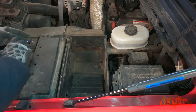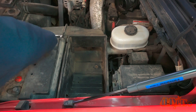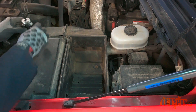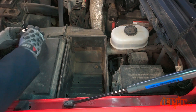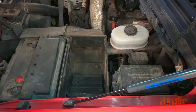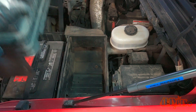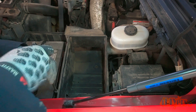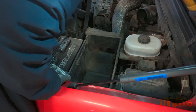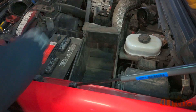Next, the battery cover must be removed. You will need to disconnect both terminals — start with the negative terminal first and then finish up with the positive terminal. The positive terminal was stuck on the battery so a battery terminal puller was used here. Finally the plastic cover can be removed and two more bolts for the airbox will be exposed. One was already missing so there is only one that needs to be removed. There will be a plastic tab that needs to be pulled out on the engine side, then lift out the airbox.